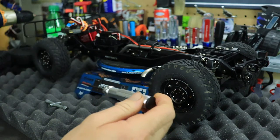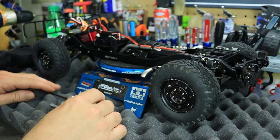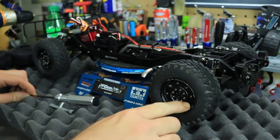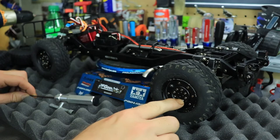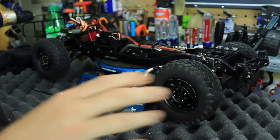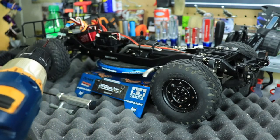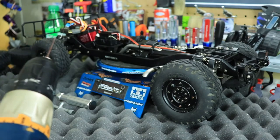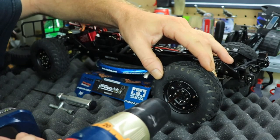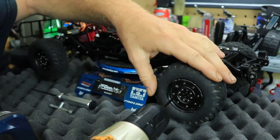You're going to need two tools: a 1.5mm hex driver and your wheel locker. I'm going to cheat a little bit on this process because we have sixteen 1.5mm screws to get out of the wheel. I'm going to use an electric drill on the lowest setting possible to avoid stripping, which will speed up the process.